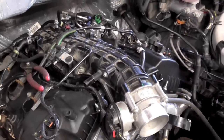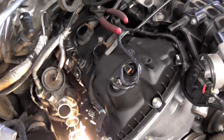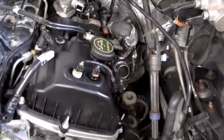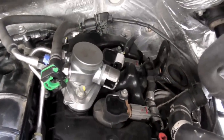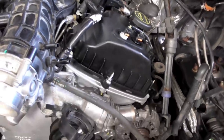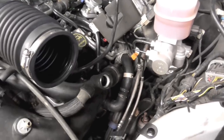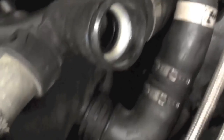So we're putting the intake plenum and different cowlings on. Next will be the turbo pipes as we do our reassembly. The long block came with a new mechanical pump, which will be nice and welcomed, and supposedly updated sprockets and chain as well. Now we're getting the turbo pipes and all the incidentals installed — man, is it cramped in here.